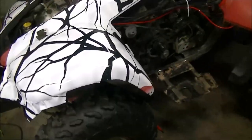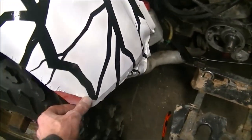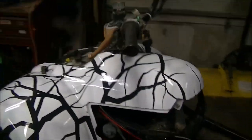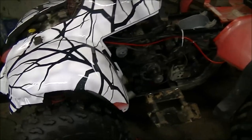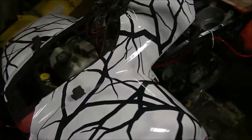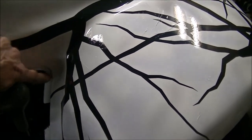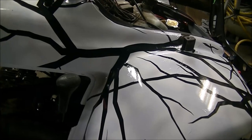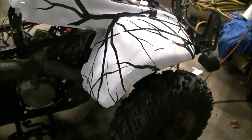Let me give you a little once-over. I'm about three and a half hours into this. I'll do my little trimming — I kind of came up short down here, so I put in a little patch; the fender flare is going to cover that. One thing I learned: when you're cutting your relief cuts, don't over-cut. When I did the other side, I cut around the shifter handle and it came all the way back, so I had to put a little patch in. There's a little white patch in there covering up my mistake, but it actually doesn't look too bad.